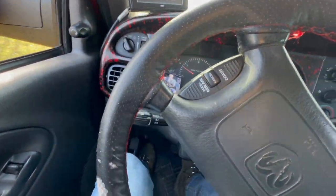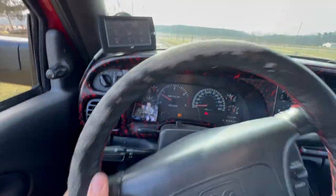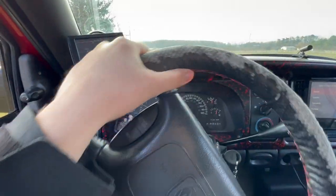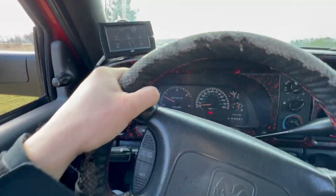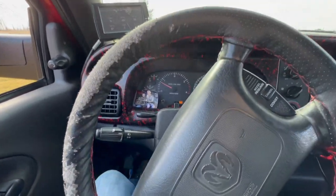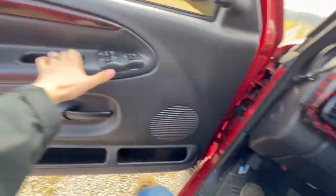I can feel it in the brakes — the truck's stopping just fine, but the amount of pressure you have to apply is more than normal. I'm assuming that's because the air in the lines hasn't been completely bled out, which would make sense. I didn't crack the line and pump the brakes until fluid came out — I kind of explained what I did in the last video — it's not technically the proper way to do it. Again, truck stops fine, you push the brakes and the truck stops. I'm going to open it up and check the lines again just to make sure it didn't spring any leaks.